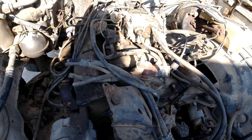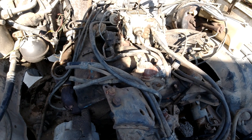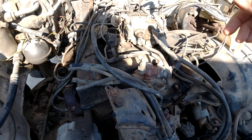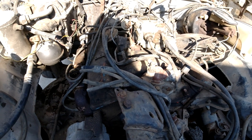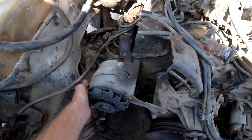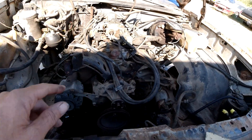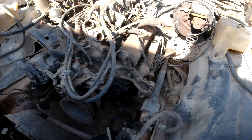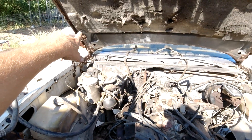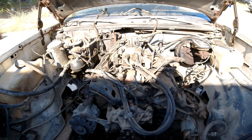Once we pull it we'll get the engine code because we want to check the other one too. I wanted to check the one in Art's car — the black '77 Malibu — because he said he put a 350 in that but we don't know what year it is. But we're pulling the one out of the gold one and want to check that back number, see what year it is, cubic inch, all that. Motor mounts, two crossmember mounts, and the starter — and we'll unhook the hinges, pull it back, get the hoist over here, and get her ready to lift up.